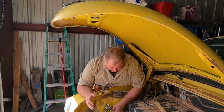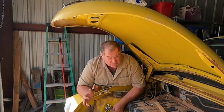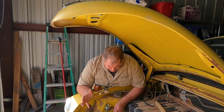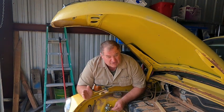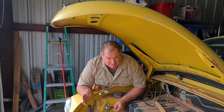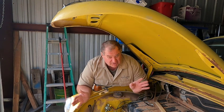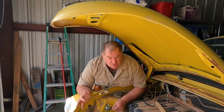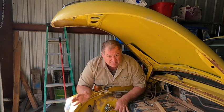Wait — this is all wrong. I could jump the small red wire to battery and it would crank, so obviously this runs through the solenoid on top of the starter. With this blue wire, I told my friend to put it in the crank position and I had voltage there. Problem is when I hook this new solenoid up — which it's hooked up right, I've done a million of them — as soon as you turn the key on, the engine starts to crank before you even hit the crank position.